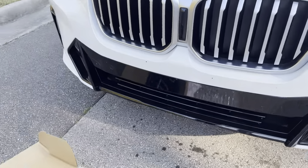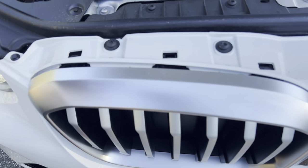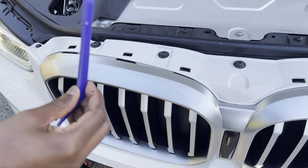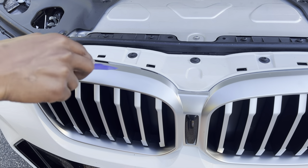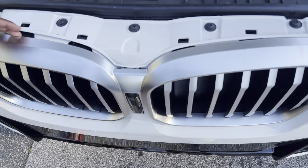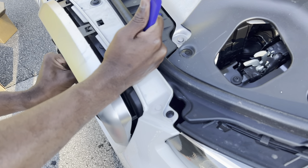Here's the back of it — it has the BMW logo, all the numbers, so it's definitely OEM BMW, not a made-in-China or fabricated item. To remove the grille, first pop your hood by pulling the release in the footwell twice. There are about six clips along the top. Use a plastic trim tool — or carefully a butter knife or flat screwdriver — insert it at each clip, push down and tilt toward the engine bay to release them. You'll hear an audible click; that's the clip sliding out of its socket.